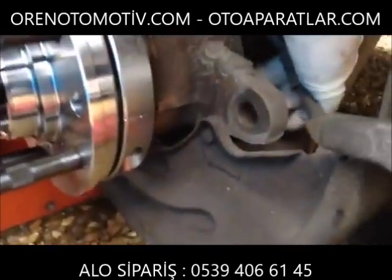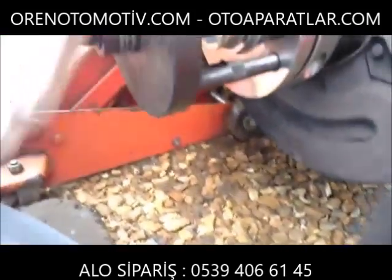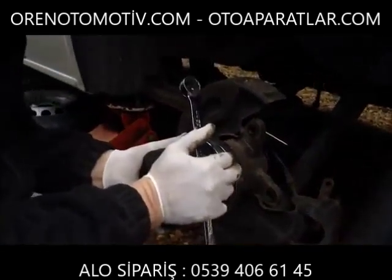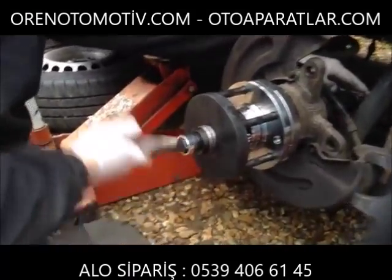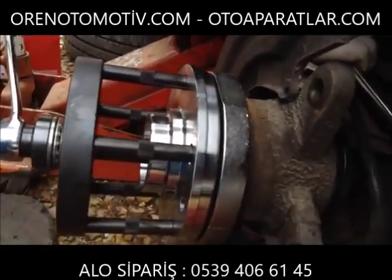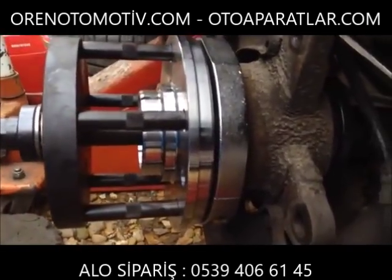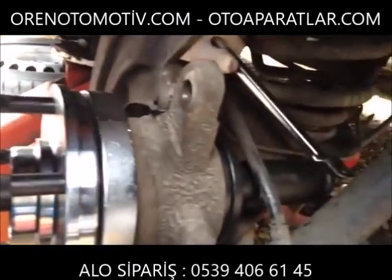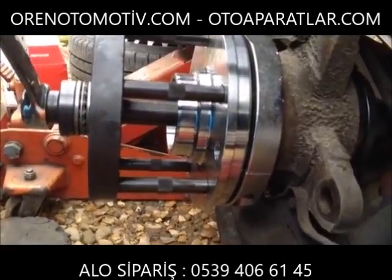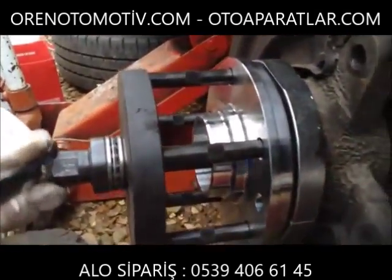This is a 30mm nut on the back here. I've just chosen to use a double hex one because it just allows me that little bit more leeway. Now push her so as she's home, take up the slack, and you want to film from the side please, and you can see her pulling it up. And you're pushing on the correct bearing faces. Once again locking up. When this goes home it makes a nice resounding clunk or click. And she's going now, she's not far away.